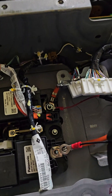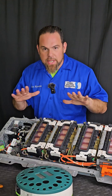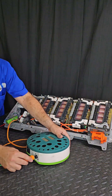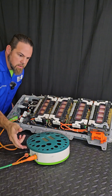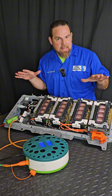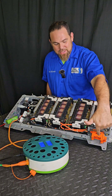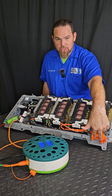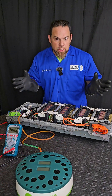The main positive is locked in. Now placing the main negative to the main negative outlet. I am now fully connected to the high-voltage battery. I hook up the charger's main connector and power it on. It's reading 248 volts output, which is exactly what I need. However, I don't see any current flowing — that's because the circuit is still open. To charge the battery, I need to close the circuit by reinstalling the service plug.